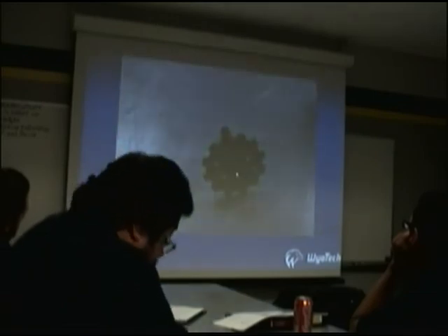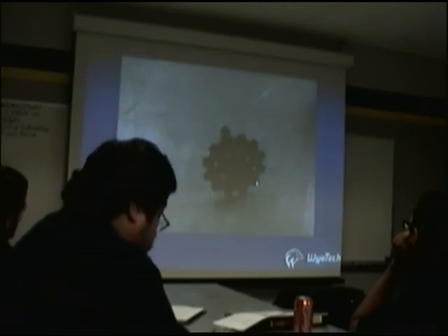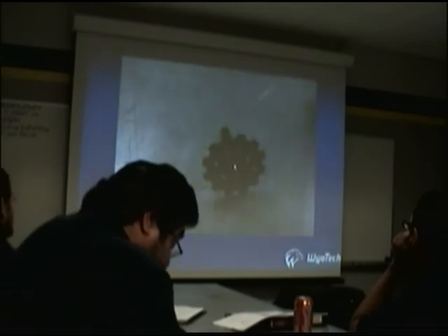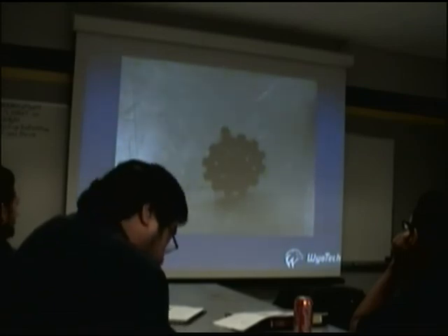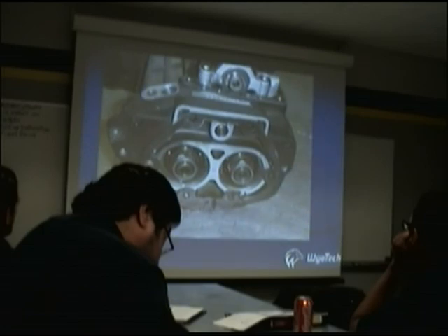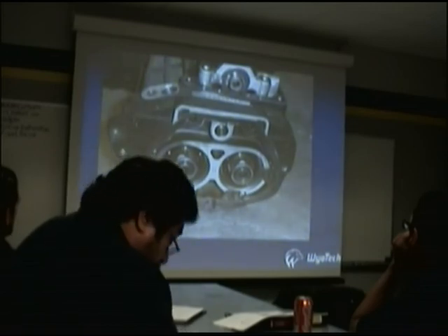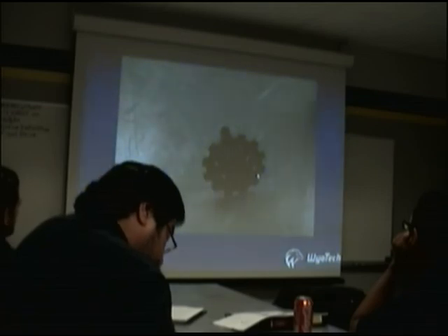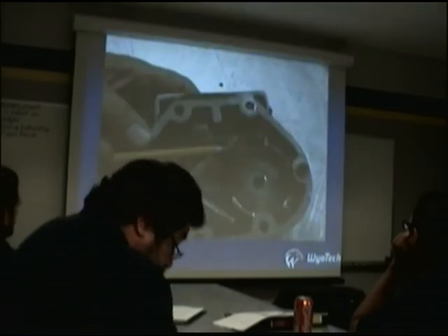There's the umbrella I'm talking about - that's for the clutch pushrod. What this does is it slings the oil off and keeps it from running down the pushrod into the primary. That goes in the end of the pushrod - that's the last thing in before you put that cover on. So it doesn't get into the primary. This hole right here is the clutch pushrod hole - this is the last piece in. What this does is it slings the oil so it keeps the tranny oil from getting mixed up with the primary oil.